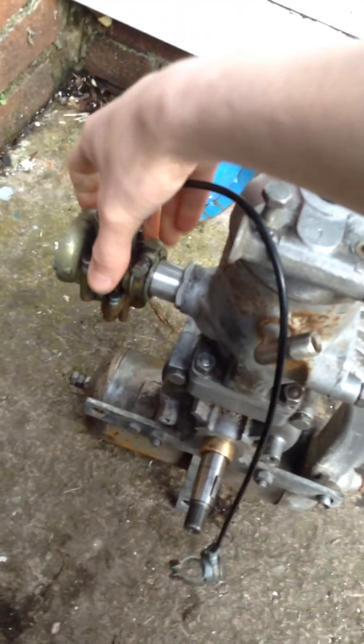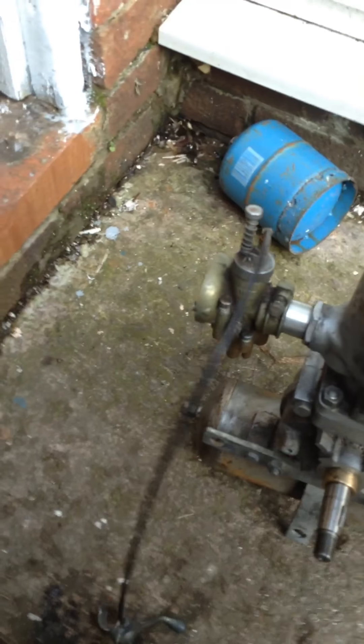So if we just pull these other pieces over - we've got the head, that sits like that. Then we've got the carburettor, which I also kind of took apart and cleaned - that goes on there. This is just loosely putting it together while I'm here. And then we've got the ignition. We need to move the flywheel first - the flywheel's the heaviest bit. We've got the flywheel; it's missing two screws, but that's not a problem because it holds it still.